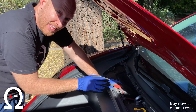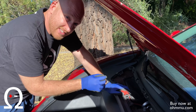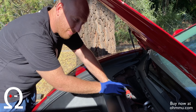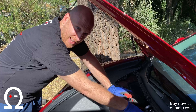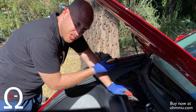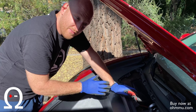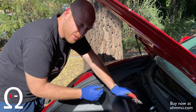The reason in an electric car that that's really important, and also different than in gas cars, is that there's a DC to DC converter in this car. The DC to DC converter could be providing 12-volt power to these lugs even when the 12-volt battery is detached. That's why we removed the high voltage interlock loop — to shut down the high voltage side of the car so that the 12-volt is totally off while we're working on this process. And it's also why if you're servicing a Tesla, you should turn the high voltage off and the 12-volt off.